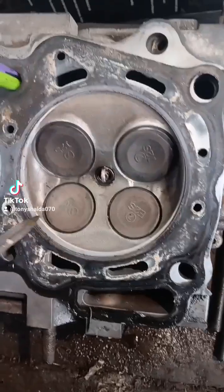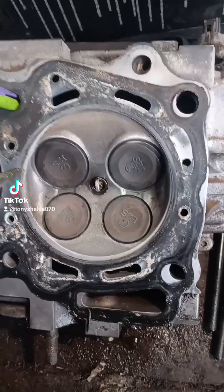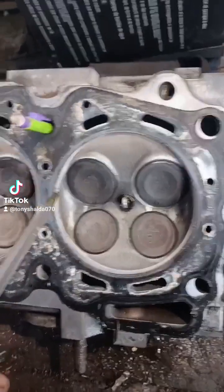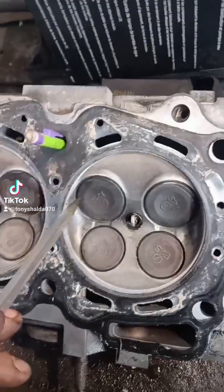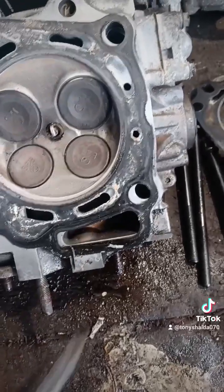I don't really think that's the problem. A traditional head gasket failure is a leak anywhere in the ring that seals the compression into the combustion chamber — this part of the head gasket is under a lot of pressure. Subaru, like any other vehicle, can experience a traditional head gasket failure if they overheat or they're assembled incorrectly. But these things usually leak down here at this oil port, which isn't under any pressure — there's just oil running back into the bottom of the engine. From 1999 to 2010, Subaru used a fiber gasket with metal inserts. They changed their gaskets in 2010, but even Subaru didn't say the problem was solved until 2016. And I get 2018s regularly with bad head gaskets. I don't think that was the issue either.